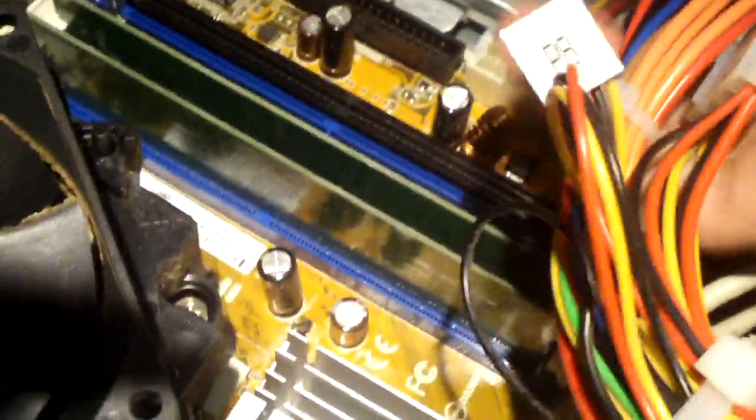Cut off again. Very strange. So, first thing I'll do is try a different power supply, just to rule it out as a potential problem. I mean, there's no telling what CPU we have here. It could be a Core 2 Duo. And without the hard drive and stuff installed, a 250 watt supply should be able to run that. It's a basic setup like this, it should run.